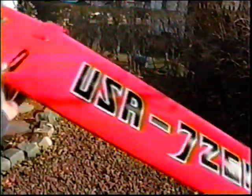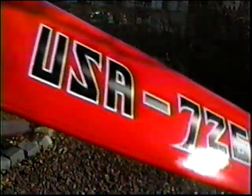just see how this looks when you can. Let's see, I can still see there's still a couple of dry spots. Let's see if we can pick them out. Dry spot right there. I can just hit that again. But that's some of the tricks you can use to make the clear go on. See, up here it's plenty wet. Down here we need to get a little more.